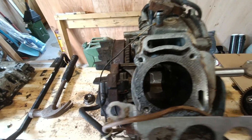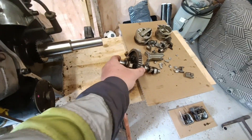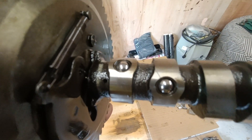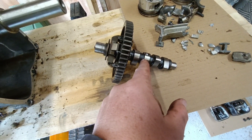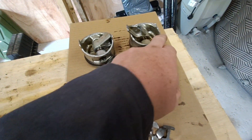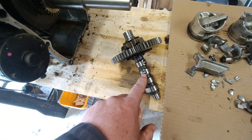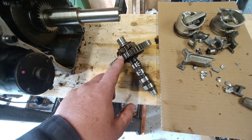I know from looking inside and feeling it — the cylinder bores look good. The only problem is the camshaft. I thought it was good but I've had a closer look at it and there's the start of a hairline crack that goes half the way around the cam. So I've just ordered a new one of those. That is all of the crap that came out of the engine — the piston sleeves were knackered, the conrods were knackered, it's just an absolute mess. I've ordered different bits and bobs. The camshaft is coming in second-hand from America — it cost me about £50 including the shipping.